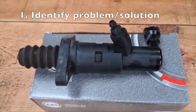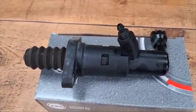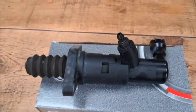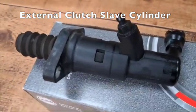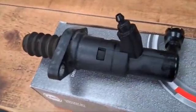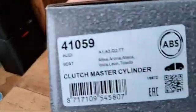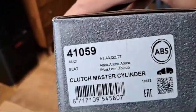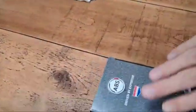I had a problem with my Seat Leon Mark III — the clutch pedal was sticking to the floor. I bled the clutch to see if there was any air trapped; there wasn't. A friend suggested the slave cylinder might be the problem. The replacement part I got is incorrectly labelled — somewhere on it it says 'clutch master cylinder' for several Audis and Seats, but it's not a master cylinder, it's a slave cylinder — an external one, which means it's relatively accessible.